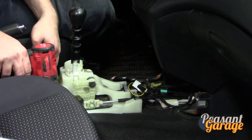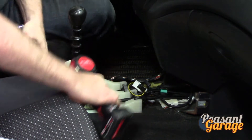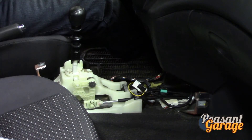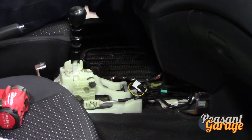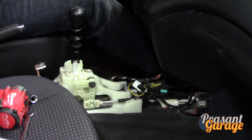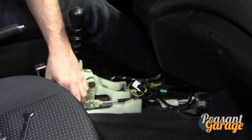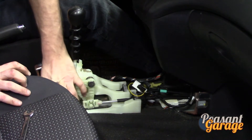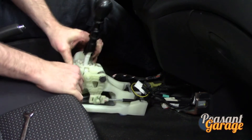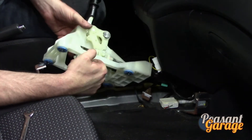We could definitely see we weren't getting in here with my big impact gun. With a longer 3/8 extension I'd be in much better shape, but I think we're just going to go old school. We'll try a slightly longer 13mm deep 3/8 - there we go, works nicely with the deep socket. Bolts are on the floor where I'll find them, and now our shifter assembly is loose.